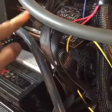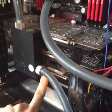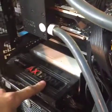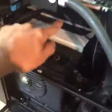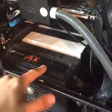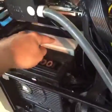I checked out a couple of reviews and it looks like each Titan draws roughly 250 to 300 watts each, so this setup should actually run comfortably with just an AX1200i. My plan is to take the NZXT out, do some testing, and if it works properly I'll leave just the AX1200i in. I might move it to the back and move the radiator downstairs.